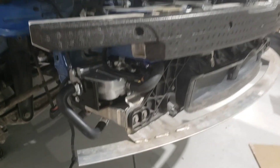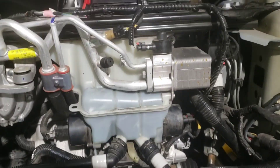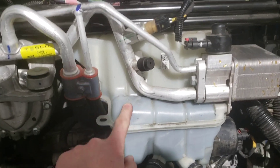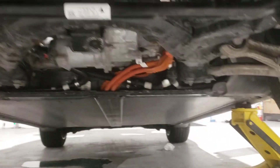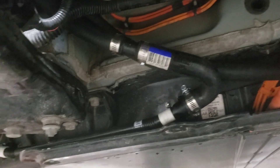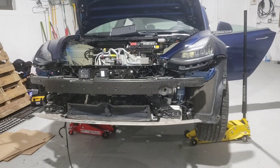Circulation tank heater is all done — installed, and we already had coolant running through it. We also made sure that we vacuumed the system, and you want the coolant to be topped off at this super bottle from Tesla. Underneath, you can tell the split between the two sides — the battery and the right-hand side. Now it's just time to put everything back on.